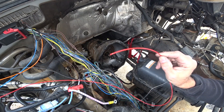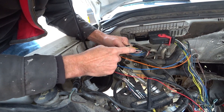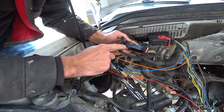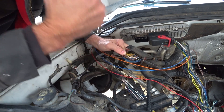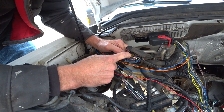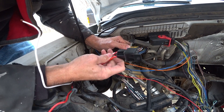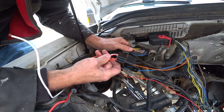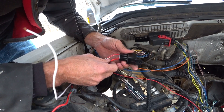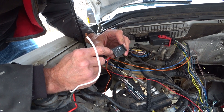I just have one wire to hook up the switch to power on. I've got it from a good source that I need to tap into this number 12 wire right here — it's blue with an orange stripe, the only one I see in there. That should supply me power on run and start. I want to wire in this relay so I'll have switch power on run and start, and I'll be able to supply power to the swap helper and other items underneath here. I'll have a convenient source.